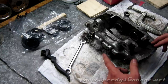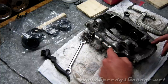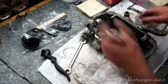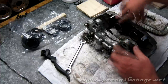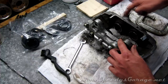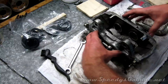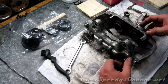Just for your general knowledge, the way a brake caliper works is the brake fluid passes into the caliper through this port. It travels through channels in the caliper — there's one that goes across the two halves, because this caliper is actually two pieces — comes back down through this channel and completes the loop. When you depress the brake pedal, it pressurizes the fluid in these cylinders and forces the pistons to contact the rotor.